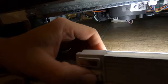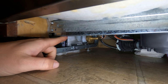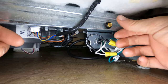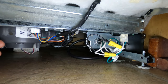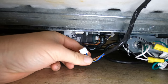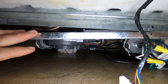It's a smart idea to turn the circuit breaker off whenever you're bringing this control panel down, and then turn the power back on so you can do the test. We need to have power on to test that 14 volts DC. Just turn power off whenever you do this step — I've done this 100 times, but you want to keep yourself safe and not cause any more damage to the machine.